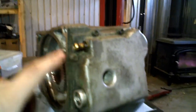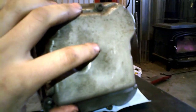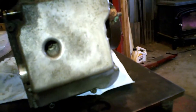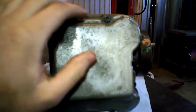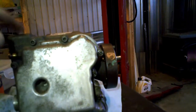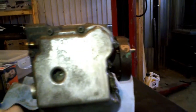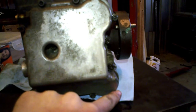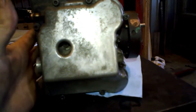But you have another thing that is not my case, but it can happen. This cover can be removed, and there is a little oil filter here to filter the oil, so there's no dirt in it. But this casing has a seal all around here, and I heard about it often, that the seal around the cap here that is bolted to the case is worn out, and you have an oil leak. So, as I was saying a couple minutes ago, if you lose your oil, obviously the pump will not be able to create pressure, because there is no oil going in, so the clutch pack will not compress right.